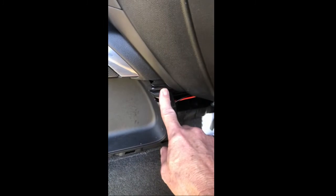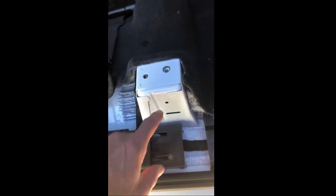You want to pull underneath, pull all these clips, reach up and pull the clips from under here. This little piece slides in, so you want to slide that panel out — otherwise you might pull and break it. This is a 2021 GMC Sierra AT4 with the center console, so just be aware. There's a piece of molding here that clips in two locations and just pops up. I removed the paneling going up to the quarter panel in that corner, and there are some clips up here that I pulled down to access and hide the wires underneath.